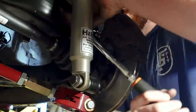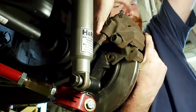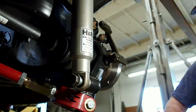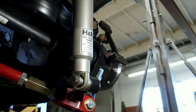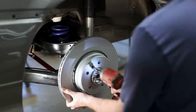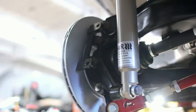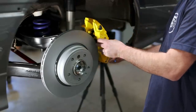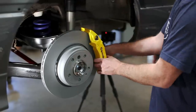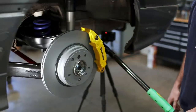At the back of the car, the process is pretty much identical. We're simply going to rip all of the old parts off and instead fit up the whole new brake system. Nothing at the tail end of the car needs any modification — the bracket will simply bolt right into place, followed by the brake rotor and then the caliper. I'll have to order some parts so that we do have a functioning parking brake underneath these rear rotors, but I'm going to worry about that further down the line. Rear caliper installation is as easy as the front — simply line up the bolts to the bracket and drop it all into place. Ignoring the bleeding procedure and installing the brake lines themselves, this installation is as easy as it gets. I installed all four corners in about one hour.